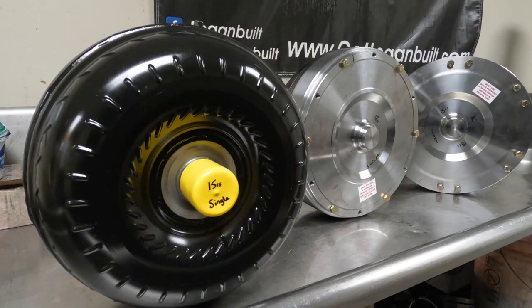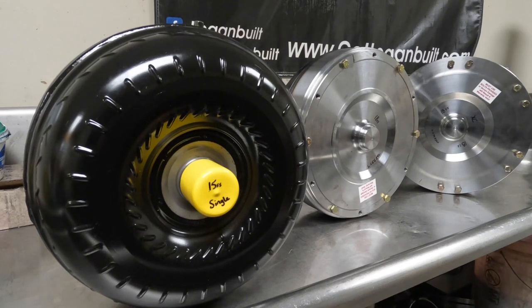The single lock-up disc is what's found in a factory-style truck — there's only one lock-up clutch inside. That limits the amount of power you can safely run through it and limits how much you can tow due to wear and tear. I rate this converter to about 500 horsepower max. Anything above that is really asking a lot of a single lock-up clutch — that's where you need to step up to a triple disc.